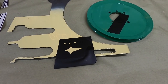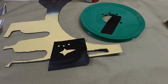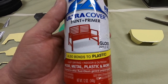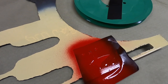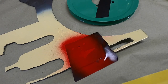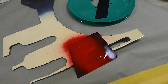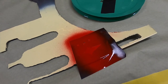I'm not going to put it on real heavy. It's raining out so I'll have to stand in the door to spray outward so I don't get overspray on things in here. This paint bonds to plastic so it should work good on the throttle knob — I can't find a red throttle knob so we'll just paint it. There is absolutely no reaction and it painted on there nicely. I'm going to let it tack up and then put on a light second coat, and then we'll peel it off after it's tacked up a bit more.